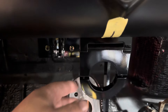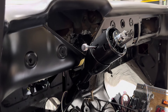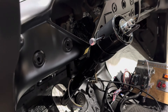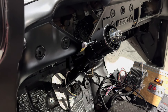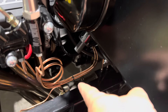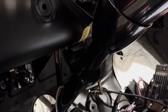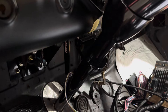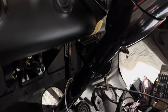I'm going to take this bottom shackle off because you can't slide it through with the connector on the column. I just slid it in and tilted it down, and already I can tell this drop bracket is no good — it's got to go. That's a two-and-a-half-inch drop when we need a three-and-a-half-inch drop, because it was making my angle too steep. The bell or top was almost hitting the dash and made the snout come out pointing almost straight down. I started loosening the bolts about a quarter of an inch and it already made a big difference in the angle, so a three-and-a-half-inch drop is where we need to be.